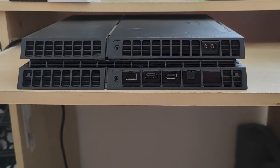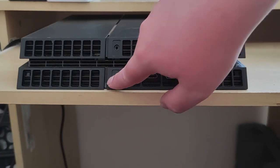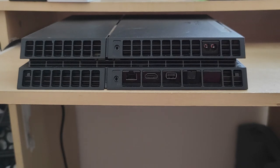So once we've confirmed you have a 1200 series machine and you're following the right disassembly guide — what do you do to get the base off if you're struggling? You need to take the two T9R screws out from the top and bottom here in the center. You can see the two screw holes here. This machine has already had those screws removed — it's one of my parts machines so it doesn't have many screws in it at all. Once you've removed those, we need to take a look at the side of the machine.